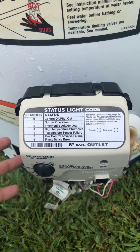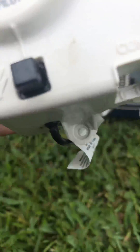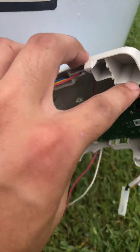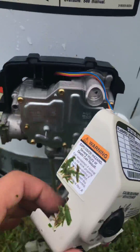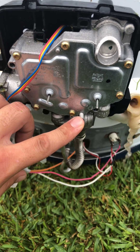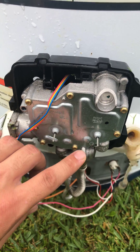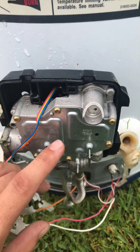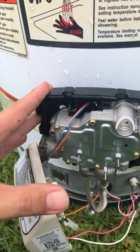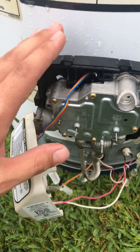There are videos on YouTube showing you how to reset this. You can take this cover off — to do so, you've got to undo a screw right here and then push these tabs in. Then they tell you to pull this little ribbon off of this board here, hook some alligator clips for your neutral or ground, the negative side of a nine-volt battery, and hook the other alligator clip to the positive side and tap it back and forth to reset it. But this is out of warranty now, so they won't send me another one for free. I'd have to pay $200 or $250 to them, or buy one from Amazon for $109 for this particular model.